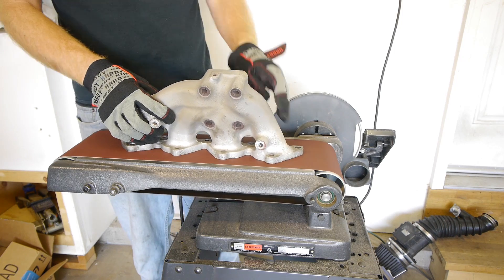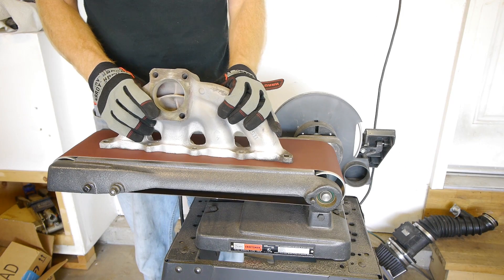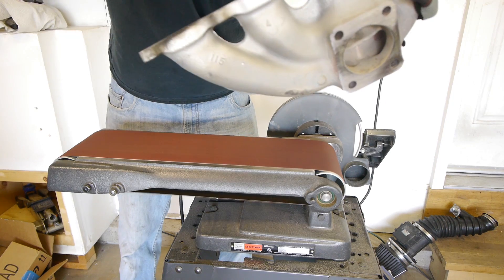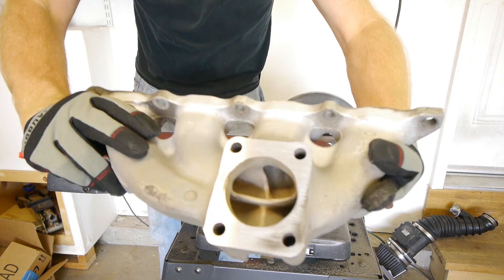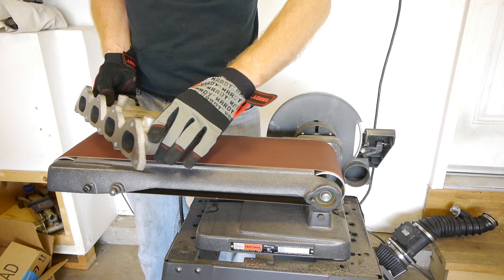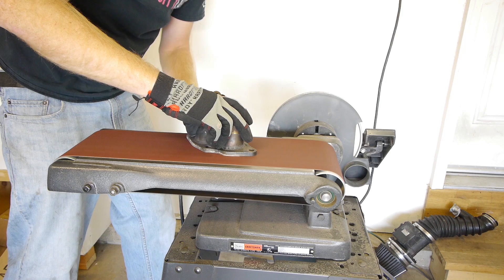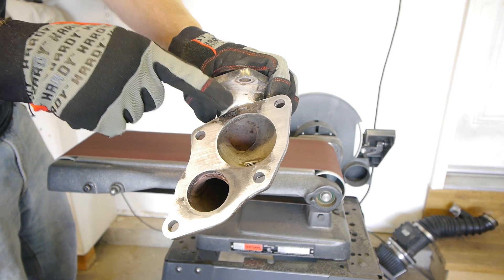We got that cleaned up and put back together, and now it's time to eliminate some exhaust leaks. I've been putting up with a few minor exhaust leaks over the past year and a half or two. So I picked up a big belt sander on Craigslist so I can flatten everything out. This is my first time using it and I'm pretty much in love. All we have to do is just turn it on, hold the piece in place, and let the belt sander do all the hard work. Any part that doesn't come clean right away indicates a low spot, which indicates exhaust sneaking out where it shouldn't be. Just keep going until it's perfectly flat. I did the exhaust manifold first, then moved on to the O2 housing. I could actually see the exhaust leak there when I did the seafoam smoke test to find them. This one took a lot of work.